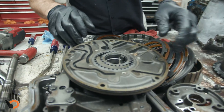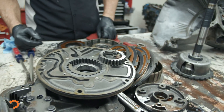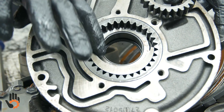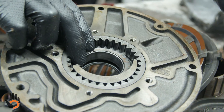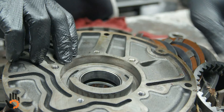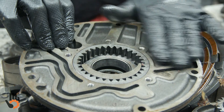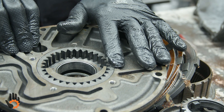The pump itself is going to be pretty straightforward. If the pump gears are available, I'm just going to put a new set in there. We're going to look down in here in the crescent and make sure there's no extreme damage. The same thing for the driven gear or outer gear itself — we'll check the pocket in there. And then we would reinstall new gears and check our clearance between the face of the gear and the face of the pump body itself.